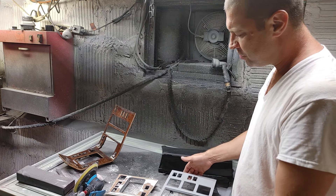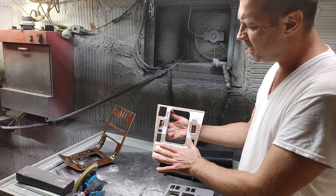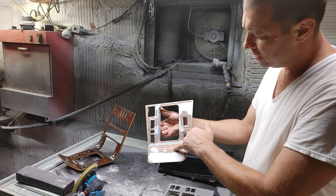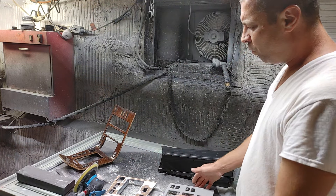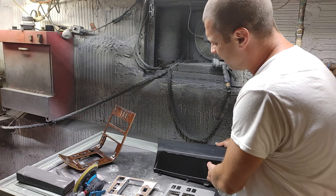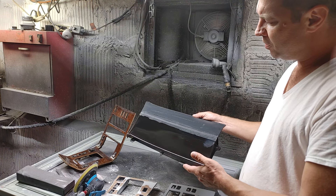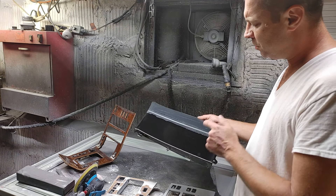This is the second panel I'm working on. It was covered with epoxy primer and sanded down to level it all out. Some pieces of wood were damaged here, so it was bondo-filled — you can see those red spots. This one still needs another coat of primer. Once it's dried it'll be ready for paint. This test panel here is what I was experimenting with — this is the paint we're going to use, a single stage, and that should be good enough.